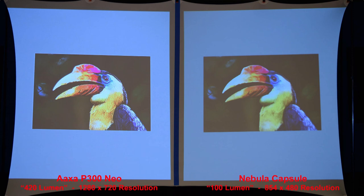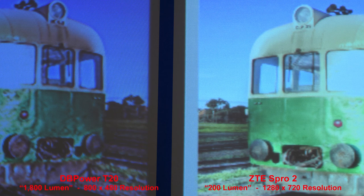My final advice is as follows. If you're always going to be using your projector in a totally dark room, then brightness isn't as important as resolution — it'd be better to get a dimmer projector with a higher resolution. If your viewing environment isn't totally dark, such as a room with windows without blackout curtains, or outside with street lights or a glowing moon, then you'll want to go with a brighter projector. But remember that cheap projectors are almost never as bright as they claim to be. I would typically pick a less bright projector with a higher resolution over a brighter projector with a lower resolution — you can always make your room darker, but you'll never be able to increase the resolution of your projector. I would personally never get a projector with a resolution below 720p (1280x720), because at a 9-foot-wide image size you can actually see the individual pixels on lower resolution projectors.